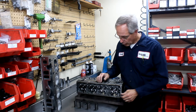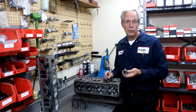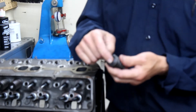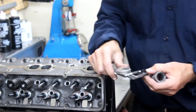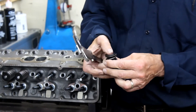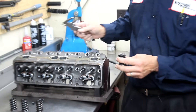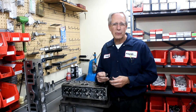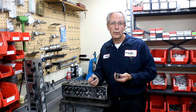The first thing we see in this warehouse cylinder head are the valve springs. The valve springs are a relatively inexpensive inch-and-a-quarter spring, which is what you would expect. But the issue with the retainer is the retainer doesn't fit the spring. This retainer is actually about 100 thousandths smaller than the inside diameter of the valve spring. That's going to create some instability — it's going to wiggle around and cause perhaps some durability issues. When we get into our setup, you'll see that the retainer fits the spring really nicely. There's really no excuse for having a retainer not fit the spring — you've got to buy the retainer anyway, so why not get the correct size.